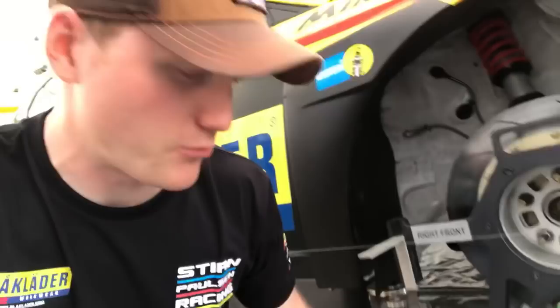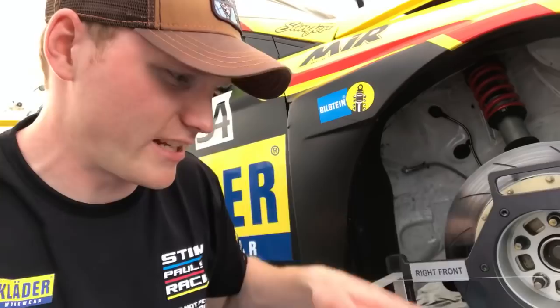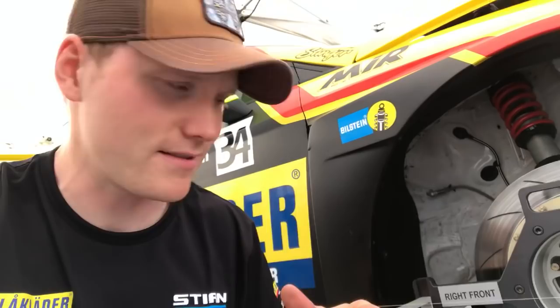It's really important and really difficult to find the right setup — every time it takes a lot of time. Between all the races we do this, and in free practice, every time I come off the track I put this on and check it. Also regarding corner weights: when you see how much weight is on each tire — if one tire has more weight than another, we adjust the ride height here to make more or less pressure, trying to equalize the weight on both front tires. It's a bit complicated but once you've done it a few times it makes sense.